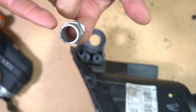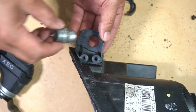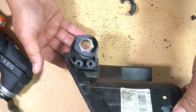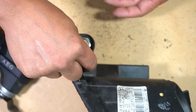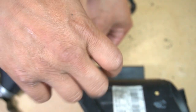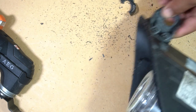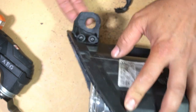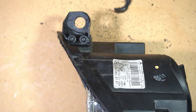Another thing is that you need to transfer over your old mounting point. This is where the bolt goes in to secure the headlight to the headlight bracket — screw it in — and this also acts as your headlight adjuster, helping you tilt your headlight up or down. Now all you do is get your screws and screw this in. Make sure it's nice and tight as you don't want your bracket to break again. That's how you replace that mount for your headlight.